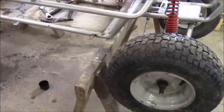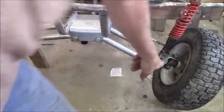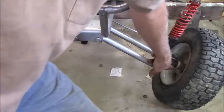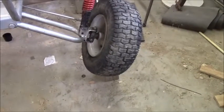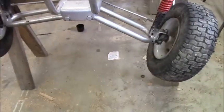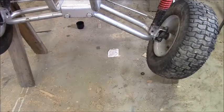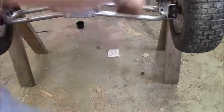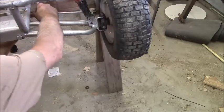There's just a big nut on this end. All those spindles are is a piece of pipe with a bolt — you can see the bolt head where they're just welded onto this pipe with a grease fitting and a half-inch bolt. Very, very simple. This had a pin bolt in it, but for now I'll just stick a screwdriver in it to hold it up. It's supposed to be up here like that, and that's as low as it can go because the shock limits travel that low.